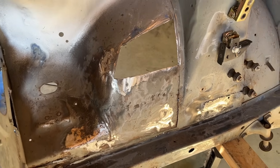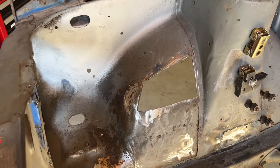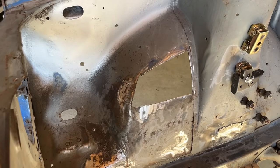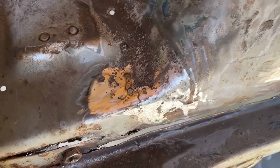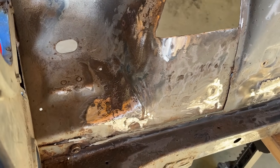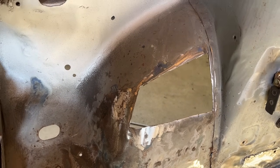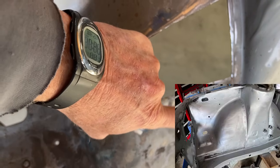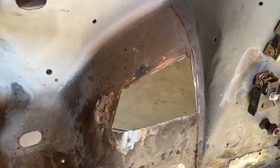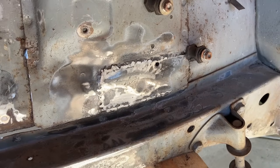There was a bracket in here - metal brackets. I don't know the 510 very well, so I've never seen it with all the stuff in it. All these brackets were cut off, and when I pulled the remaining parts of the brackets off, there was a ton of rot behind this. This is really thin, and there's actually a hole in here you can see. I'm just going to seal that up. Behind that it was just rotted out. Instead of keeping that curvature, I'm just going to take that out - it's a lot easier to weld patches like that. That's where the battery box was, but we're going to use a lithium two-pound battery to start the car, so we got rid of that part.